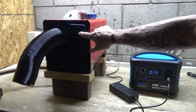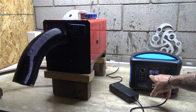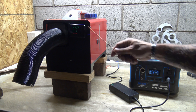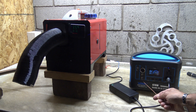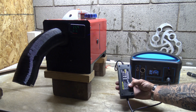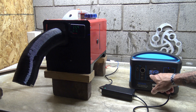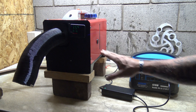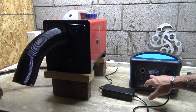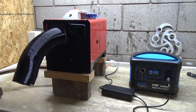I've got this unit already started and it's on the highest setting. At the most, I'm pulling about 45 watts. Now, that wattage does not include the startup watts that it takes to get the glow plug hot enough to get this thing fired up. If we look at this 12-volt output right here, this is only 10 amps at 12 volts — that's not enough to fire up this unit. So this brick that I use is 12-volt at 15 amps, and that's sufficient, that's plenty, to get this thing fired up. This draws about 150 watts to get that glow plug started. So again, on the hottest setting after the unit started, the max that I've seen is about 45 watts — which is fantastic, that's nothing.